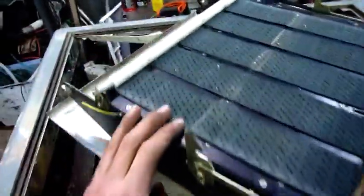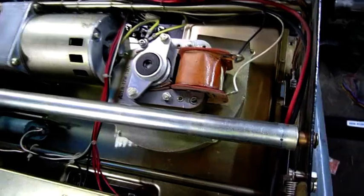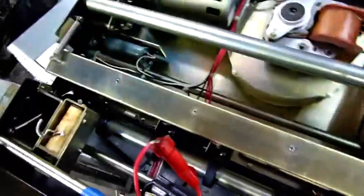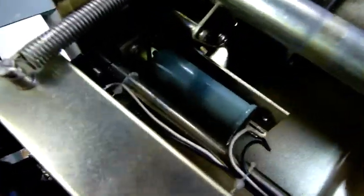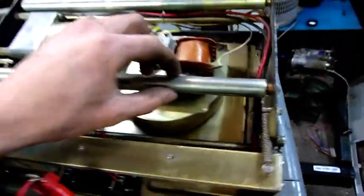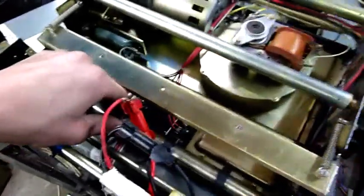Let's crack into this panel and pull this thing apart — see what's inside and if there's anything really useful. Then I'll get on to moving the optical assembly out of the main chassis. Now it's no wonder this side feed unit is so heavy. It's got a centrifugal blower pulling a vacuum on this side to keep the paper on, plus corona charge to help it along. It's also got a nice geared-down induction motor with a little oil capacitor on it. Definitely keeping those. These shafts are solid steel — almost 20mm in diameter, good stuff to turn down on the lathe.